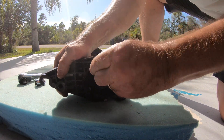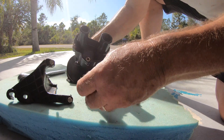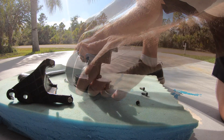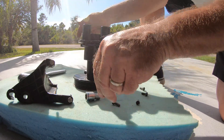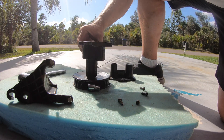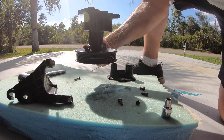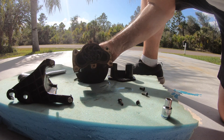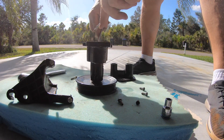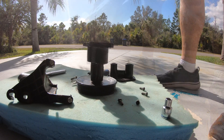Make sure you put those longer bolts back in the same place. Once you get the housing apart, you'll see that there is a rubber impeller and then a wear plate on the top and bottom. When you get a rebuild kit it comes with the wear plate, and when you just get the impeller kit you get the impeller and the little O-ring-type gasket that looks like Mickey Mouse ears. I couldn't move the old impeller at all — I guess it had overheated — so I tried a variety of tools to get it out and finally was able to.